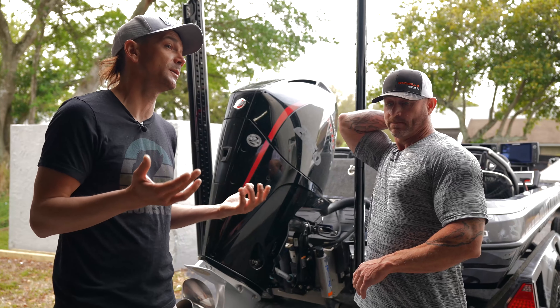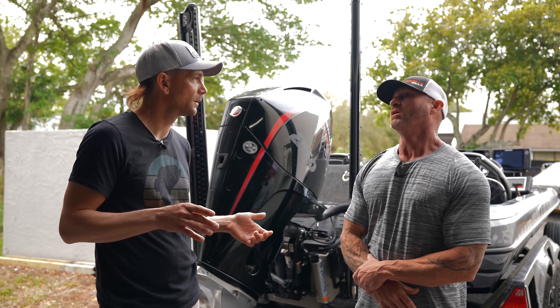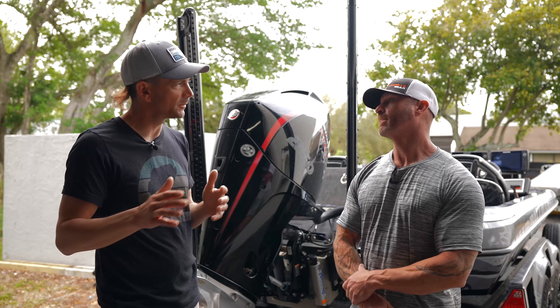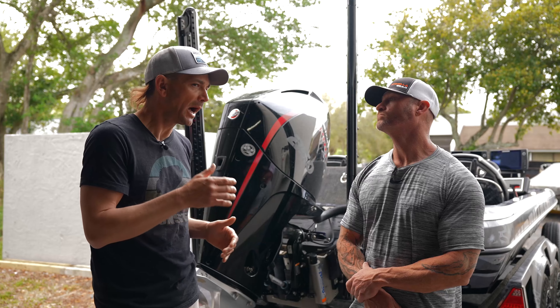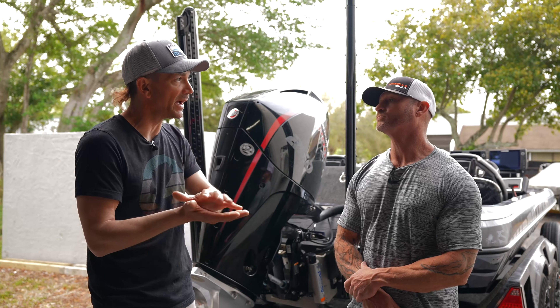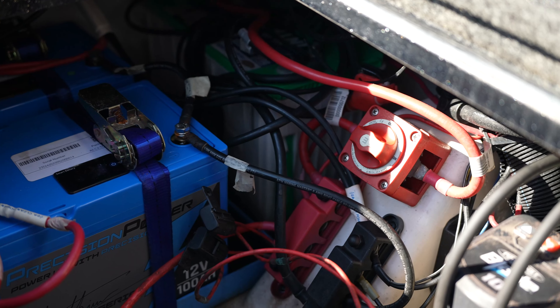So when you're talking about balance, that's something you look at before the prop. Where do I want most of my weight on a bass boat? Depending on the brand, I would say midship to further back. So I need to rearrange my tackle midship to further back. I have lithium batteries, and I know in some boats that makes the back lighter and can take away from performance — or is it a question of how you place those lithiums?